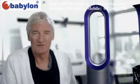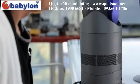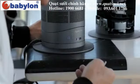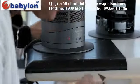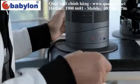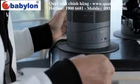You have a controller which you can work from your armchair, a remote controller. So you switch the machine on, you can hear it running. You can have oscillation, which is very useful for distributing the air very quickly in a wide volume. You can dial your temperature. Now I've got it initially set at 1, so I'll increase it, here we go, up to say 30. Now the heater's on, and it will heat the room until the entire room is at 30 degrees, and then it'll switch off. I can choose a fan speed setting, so that's maximum, and then I can drop it back to a lower setting if I want to.